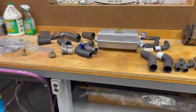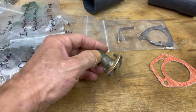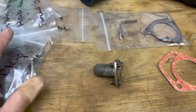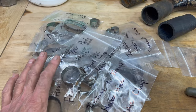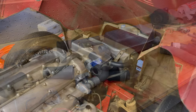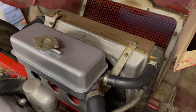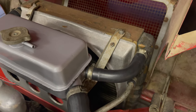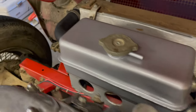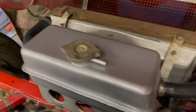Now we're going to go ahead and put all of this stuff back in and put all the hoses on. I'm going to use a little bit of sealer around the thermostat housing because these leak and this one is slightly bent from someone over-tightening it. It's late on a fall evening but I've got all the new hoses in place, done with the original Cheney hose clamps all back in their original spot and orientation. I only cleaned them up with a toothbrush and Simple Green.